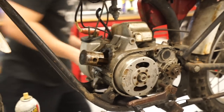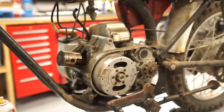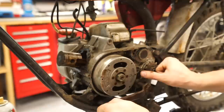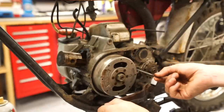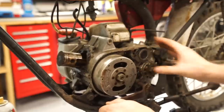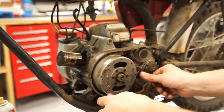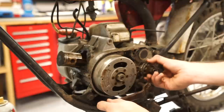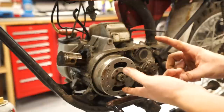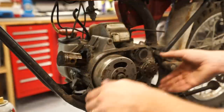There, we're getting nothing. So I need to mess with this side over here a little bit. I'm pretty sure this is the clutch rod here. I'm not really getting any movement out of that because I'm thinking maybe I can just activate the clutch. Maybe the clutch is stuck. Say, okay, so maybe it's in gear and the clutch is frozen and that's what's keeping everything locked